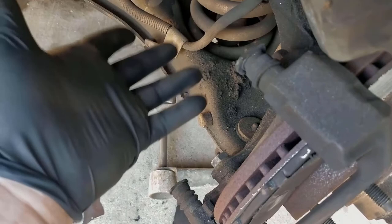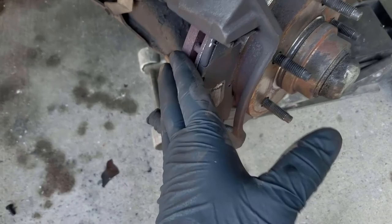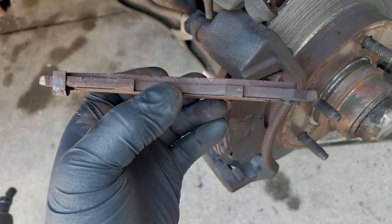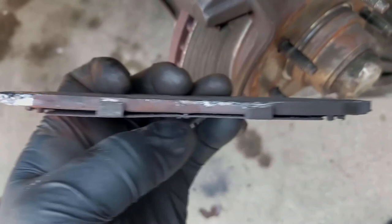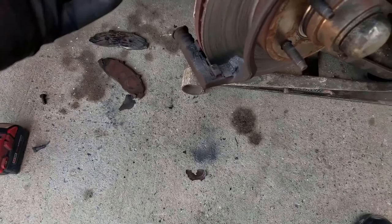Removing this is not too difficult. You've basically got two 13 millimeter bolts — that'll be different sizes for different cars. But most disc brakes are laid out the same way. You have slide pins here, which have bolts that go through the back, or sometimes the bolt is the slide pin. Either way, that's what holds the caliper to the bridge or the bracket, right here. Then you have two bolts on the back that hold the bridge over the rotor. This is the rear-facing pad, which you can see already doesn't have much pad. One side is considerably thicker than the other. On the front, this pad is gone — the metal backing plate has worn into the rotor and done quite a bit of damage. The pad actually even tried to come out of the bridge.